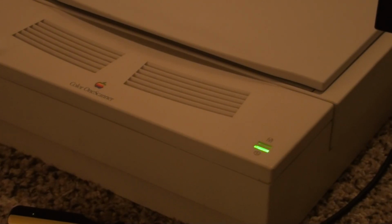You should also check the lamp holder connector. Check that the label of the fluorescent lamp faces down into the lamp holder. You could also replace the lamp or the optical assembly. It might just be a matter of jostling the lamp around, I don't know. But let's take a look at something else before we do that.